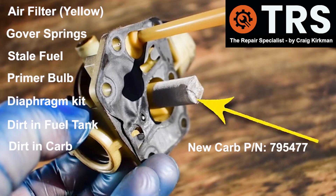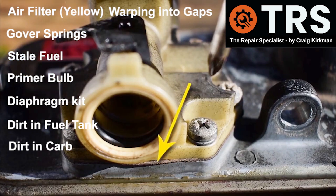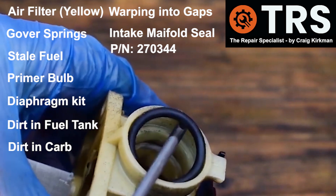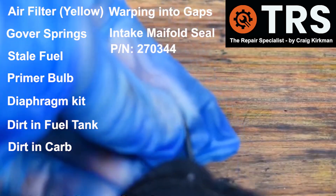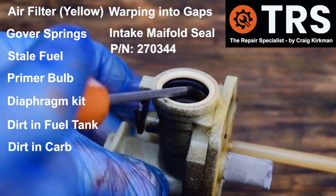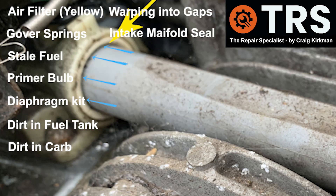The carburettor itself can get clogged and reduce its efficiency. Due to warping of the components, slight gaps can appear between the two bolts where air can be drawn in and fuel can spill out. The O-ring on the intake side of the carburettor, which fits onto the intake manifold, can get degraded or damaged, or be forgotten when reassembling. Sometimes when the carburettor is fitted back, it can slip out of place — in any of those cases, air is drawn in at the junction between the carburettor and the tube, and the engine won't run right.